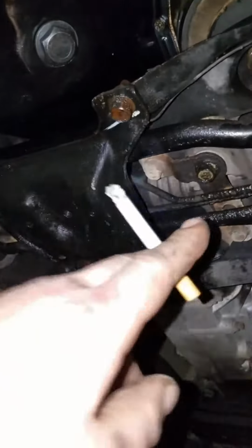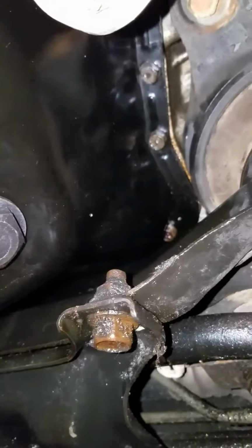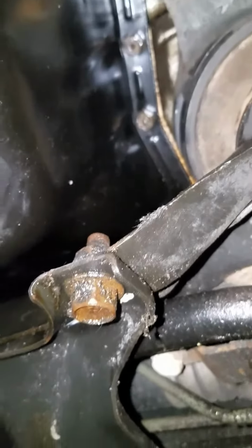All right, so when we looked at the oil pan, it's pretty tucked up in there. You think you got to take off the subframe, the K-frame that holds the rack and stuff, but actually the way we did it was a lot faster and I think a lot easier. Well, we dropped the exhaust. That's actually not very hard.